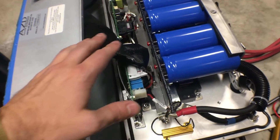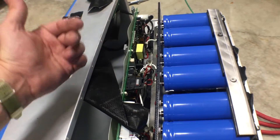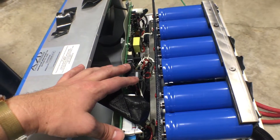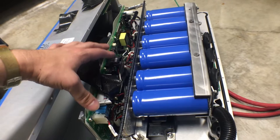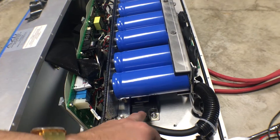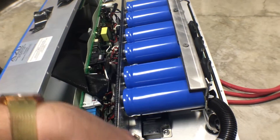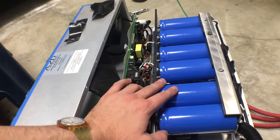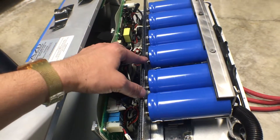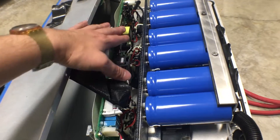So now I've got this thing up on its side. I thought I'd give you guys a better look at some of the guts in here. This is the board that the Arduino is talking to, faking the funk and just sending it all the right CAN messages to make that work. The other alternative some DIYers do is swap out the big power components like these IGBTs and make a clone of this with their own controls. It's six one way, half a dozen the other - it depends on whether you can reverse engineer the messaging. Sometimes it's proprietary and in their particular skill set it might be cheaper and less time consuming to just replace this main board.